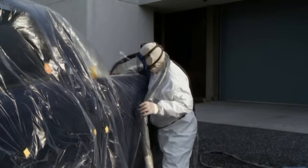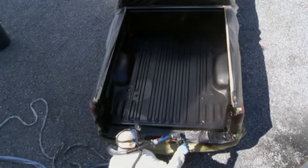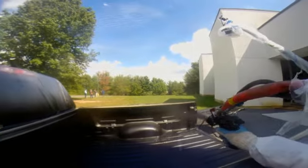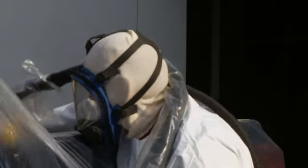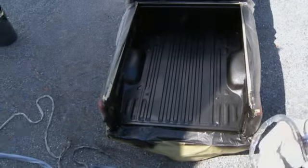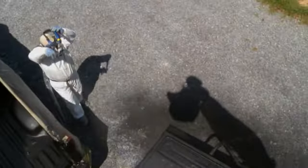Getting enough thickness around the edges — we like to have a full quarter inch around the tailgate opening and around the edge of the tailgate. Usually on the average pickup truck you'll spray the sidewalls three to four coats, and on the floor sometimes six to eight coats to get your mil thickness that you require. When you get the bed done, you go back to the tailgate and finish it up with your third and fourth coat.